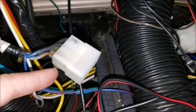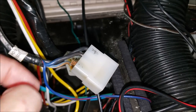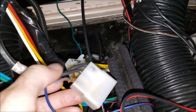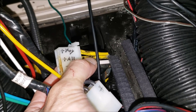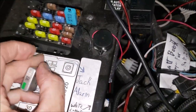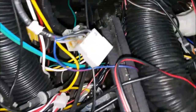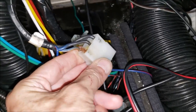A friend of mine had the same problem happen to his — his wire was melting the same way. This is actually our ground wire, and these are our two hots. Another odd thing I found: they're fused differently. This 30-amp wire in the middle is fused by a 30-amp fuse out on the front firewall, while the wire next to it is fused by a fuse right here on the dash panel. I've got it pulled at the moment because I'm about to unhook all these wires and do some reconfiguring, and I want to make sure there's no power anywhere.